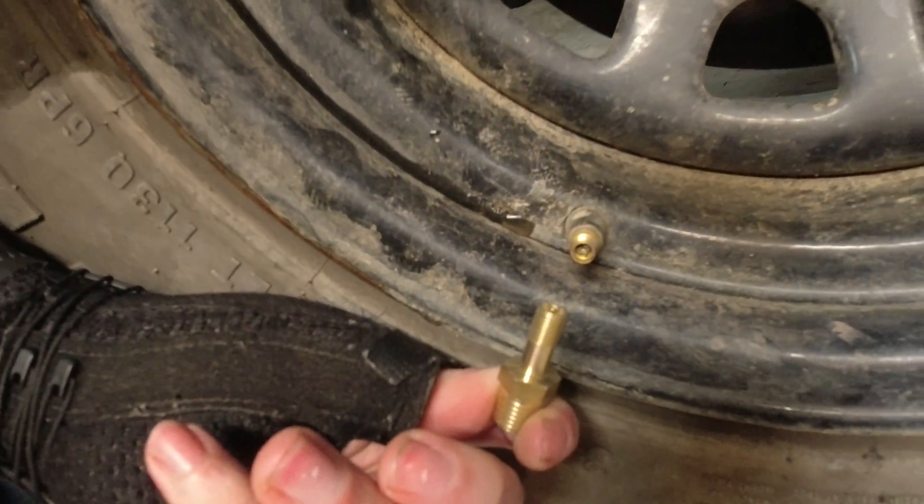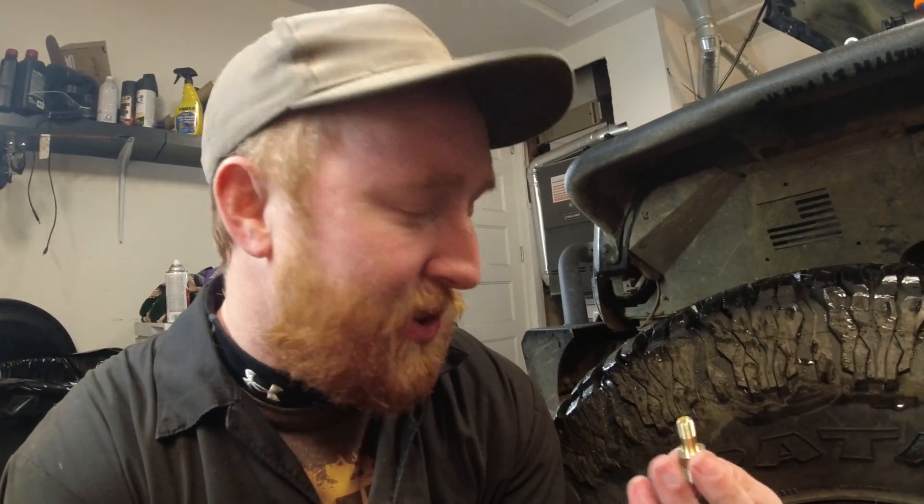For the individual hookups down in the fender wells I'm gonna use Schrader valves. Look familiar? These valves are identical to what your valve stems are — they're just on a piece of metal instead of your wheel itself. The limiting factor in the whole system of airing up and airing down your tires is actually this Schrader valve — it is your valve stem.